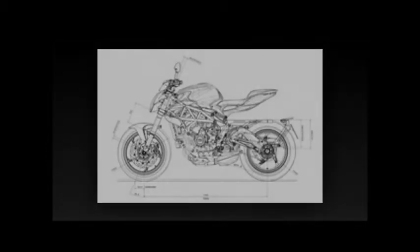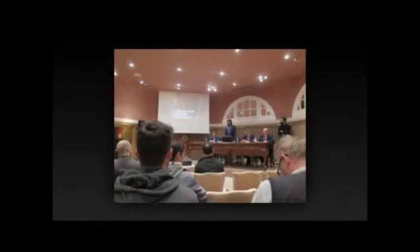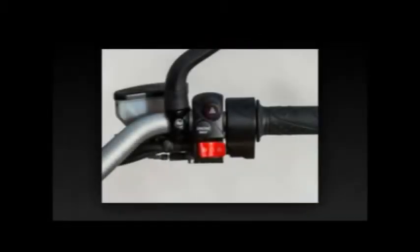Things had dried up for the most part on the way back down the mountain with a few wet areas left in the shade, and I furtively sniffed toward the Brutale's performance edge like an aging badger. Gillen, who's a refugee of Buffalo, New York, says they raised the center of gravity of the bike a bit, and gave the rear suspension more negative travel, to promote increased weight transfer and therefore increased mechanical grip via the bike's all-new Pirelli Diablo Rosso 3S, trickle-down knowledge from racing.